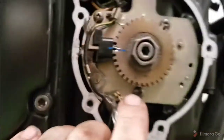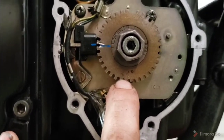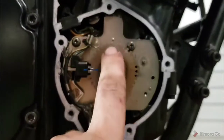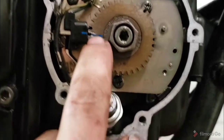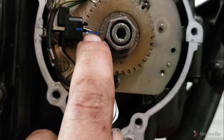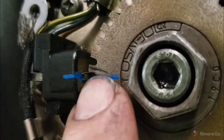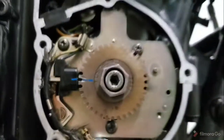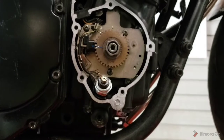Anyway, next step, we're going to start setting timing. So, your trigger wheel won't look like my trigger wheel. We will be going over my trigger wheel and everything in the next video. Okay? Yours is going to have points and a flat spot. On one of your points, you're going to see a little hairline mark. That line is equivalent to this little blue line. That lines up. See where this blue line is? There's a steel blade right there. Lines up with that. When you're lined up with that, you're at top dead center, number one cylinder. Doesn't matter which rotation because you're setting the rotation right now.